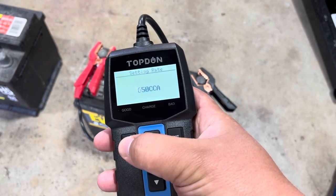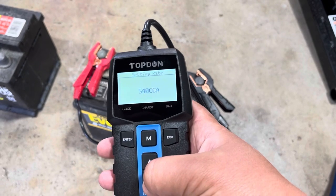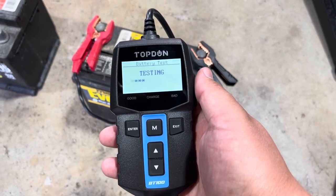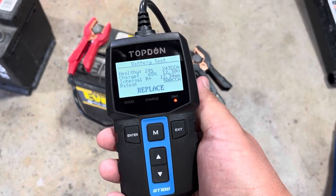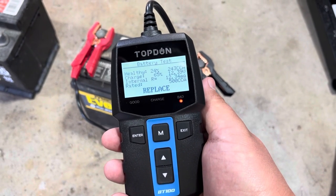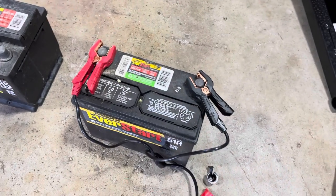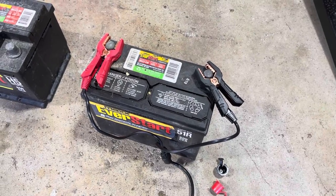Regular flooded CCA — let's bring it down to 500 CCA. I don't expect it to do anywhere near that. So 500 CCA — replace, 243 CCA, 24%. Much higher internal resistance than the other EverStart Max battery. We were rated at 500 CCA and this did 243. This battery was replaced in our CR-V, so that's why it's sitting in the pile.